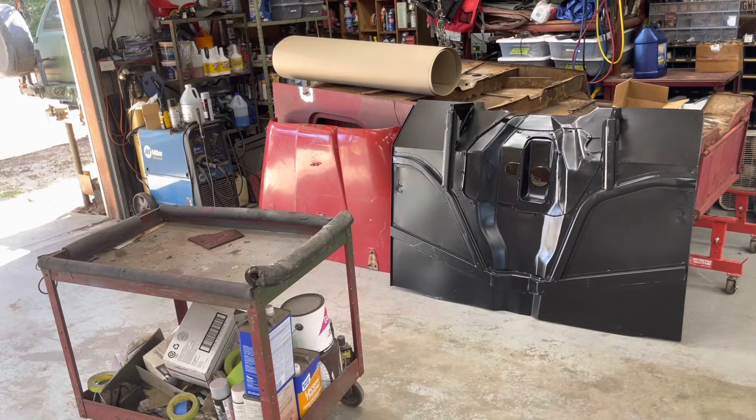So today is DA sanding, waiting for the compressor to finish airing up so I can start making a bunch of dust. Speaking of which, that hood is from the 60s, which means the paint on it has lead in it. So wearing a respirator or a mask of some type is a very good idea. Because if you do this enough, lead poisoning is a real thing — you don't gotta get a shot to get it, you can get it just by breathing in too much. Something to keep in mind.